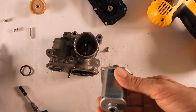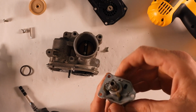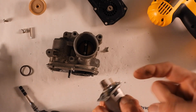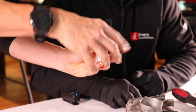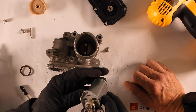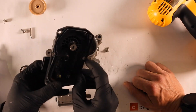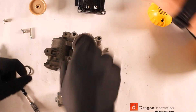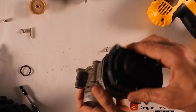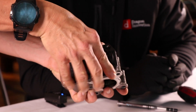This feels like a pretty slick motor — probably just a standard brushed motor. These features are doing the assembly of the motor — somehow that snaps in. It holds the body — the can. The can is these two fingers that come up, and they must have a tool that pries them apart and holds it in place. Is there any number on this? It's non-generic except for the AG-13. You can see Denso — the manufacturer of at least this part. There's also a cool feature: this post here is going to locate right there, and there's a little raised flange that makes it sit and go together pretty nicely.